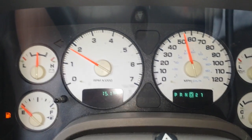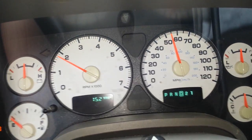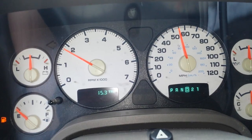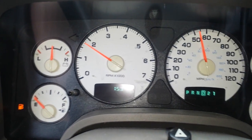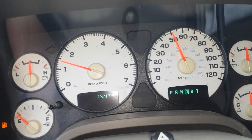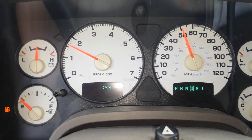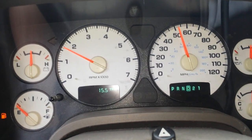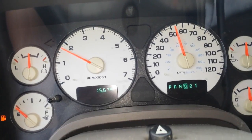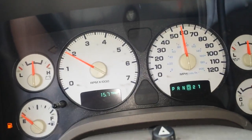Now, the check engine light finally came on because my speedometer stopped bouncing and just stayed at zero for probably 2 days straight. The code was P0500, and that points to the sensors. I went ahead and changed all three sensors. There's one on the top of the differential housing and two on the driver's side of your transmission housing. They're not the same sensors. The two on the transmission for my model year and model are the same as each other, but the one on the differential housing is a different model number sensor. And that one comes with a little wire clip with it too.